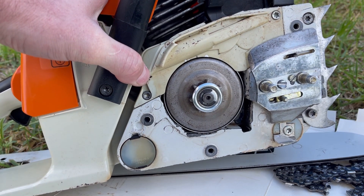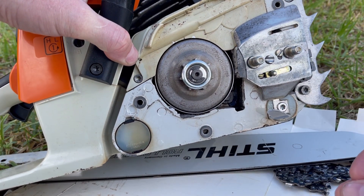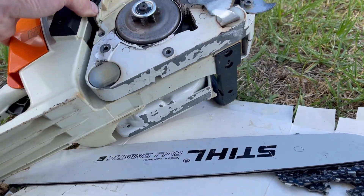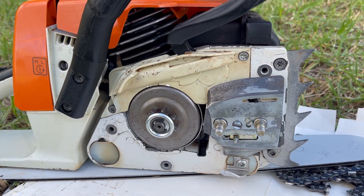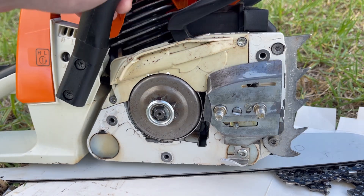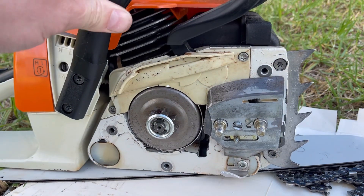Although this one's quite unlikely I'm going to mention it anyway. If any of your case bolts come loose — there are about seven or eight that hold the two cases together — that can create a gap between the case halves and cause a leak in your oil tank. You'll likely notice accompanying symptoms like sucking air or burning oil, so there will normally be much more troublesome running issues that you'll encounter first. It's very unlikely but it is a possibility if those bolts haven't been tightened or have come loose.